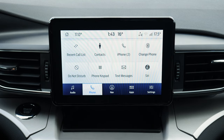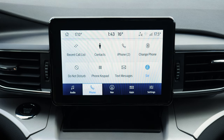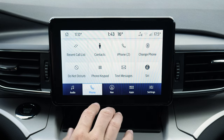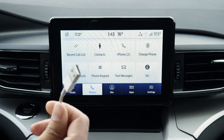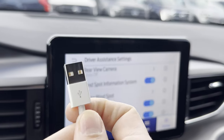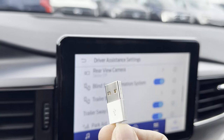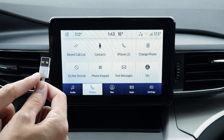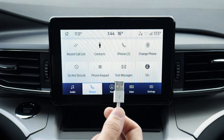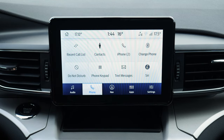You've got Siri assistant — you can do a press and hold on the steering wheel if you wanted to activate Siri that way. One thing about the SYNC 3 screen is that it has support for Android Auto and Apple CarPlay, but it is a wired connection, so you need a USB cable — and it needs to be a data connection cable too. You can make out the little data icon on the port. If you're trying to connect to Android Auto or Apple CarPlay and it's not working, the first thing I'd recommend is making sure you're using the right type of cable.